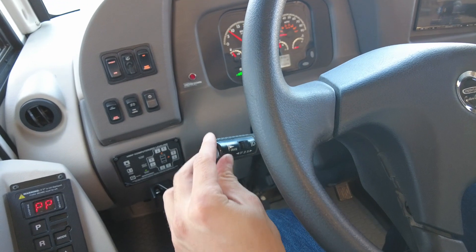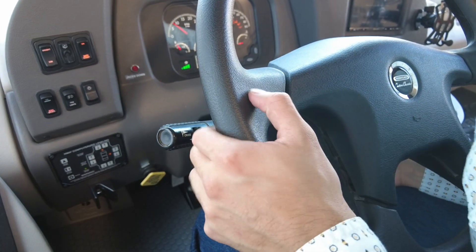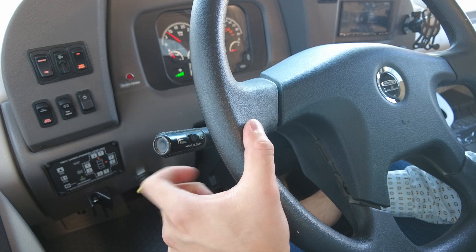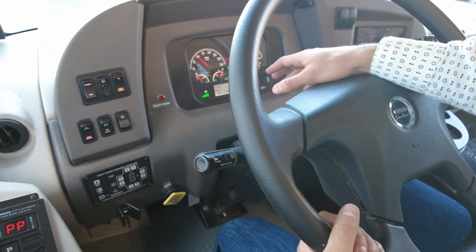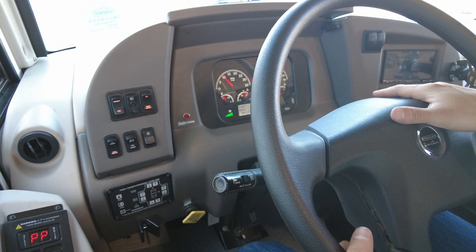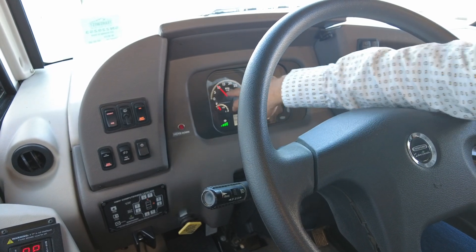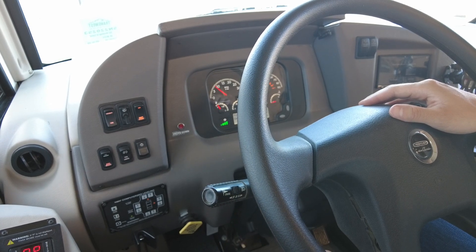On the turn signal switch you have this little switch here, which is for when you're driving. To turn on your cruise control, you can leave it on and then set it while you're driving. When you're stationary and you click that, the vehicle automatically goes into high idle. If you're going to be at any idle period — stopped at a hospital or anything like that — and you have to have the truck on, I always recommend putting it into high idle. To take it off high idle, just turn your cruise control off and it'll turn back off.